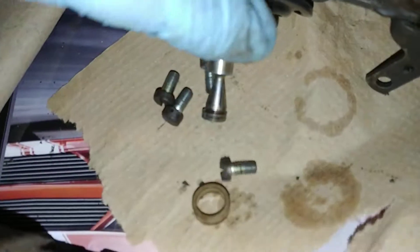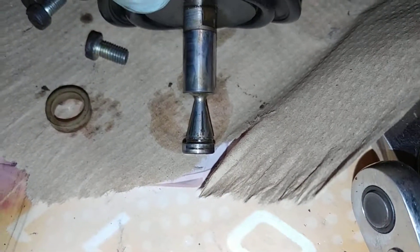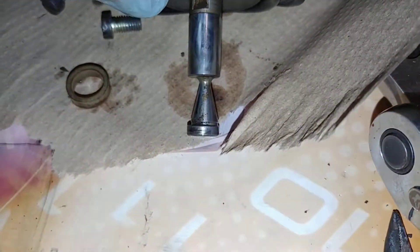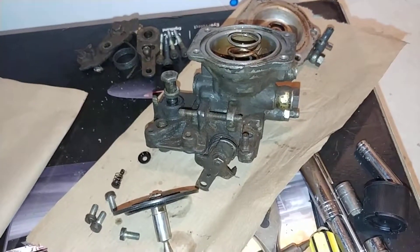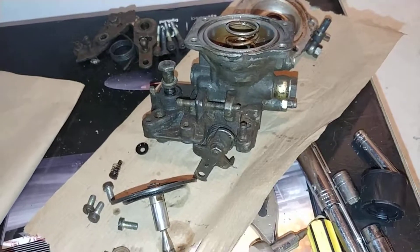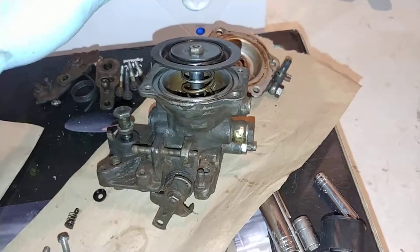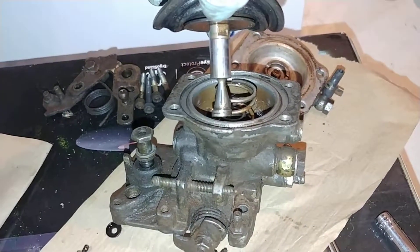A lot of people will have videos where you pull this out and if you actually look at this mechanism, it's not perfectly centered. You can actually see a little line where mine has been rubbing — that's probably the narrowest side because it's not centered in the middle. Simply by rotating this you can, for free, gain a little bit of additional fuel and a little bit of additional horsepower. So that covers the smoke screw and why it sets your pre-adjustment starting further down on that ramp.